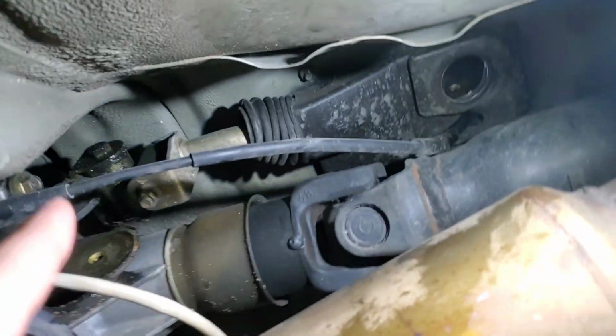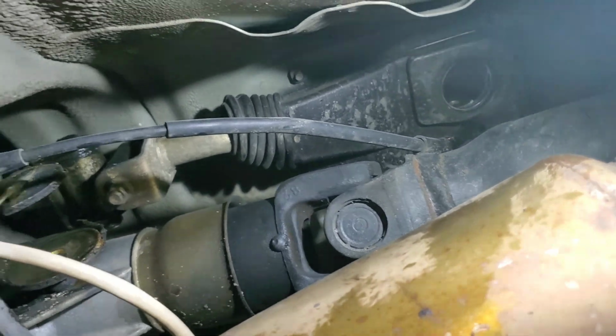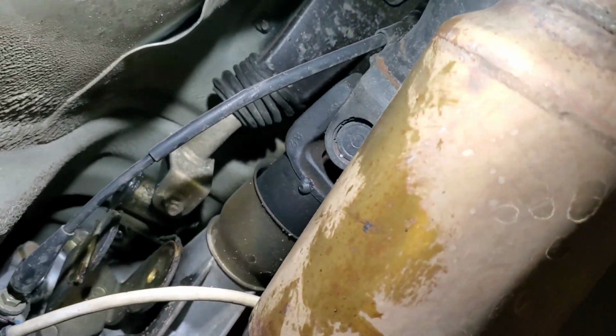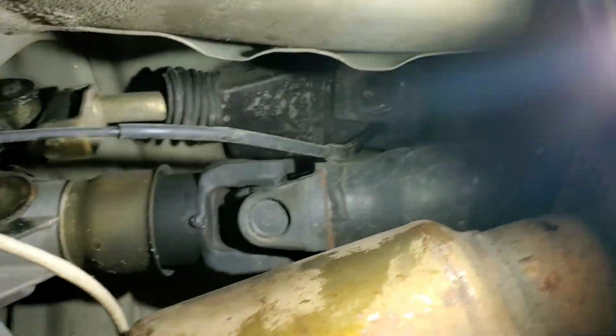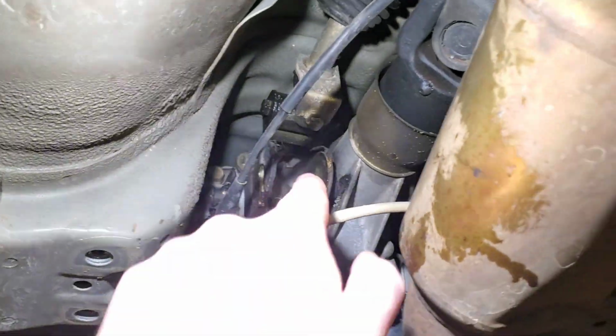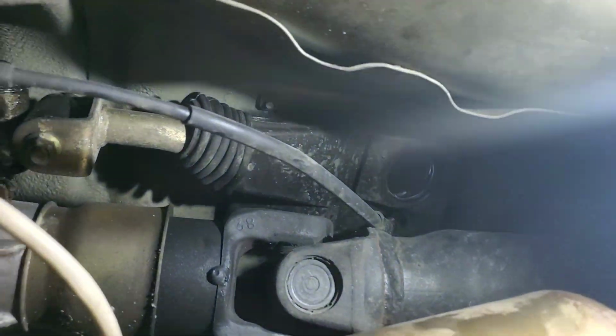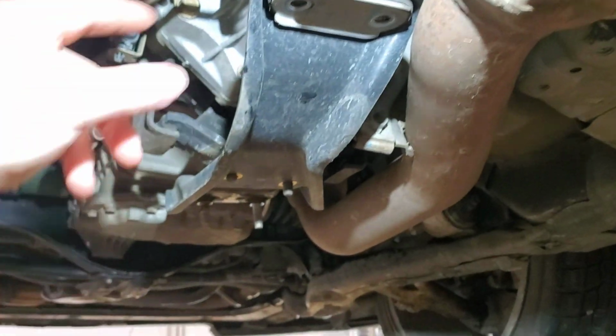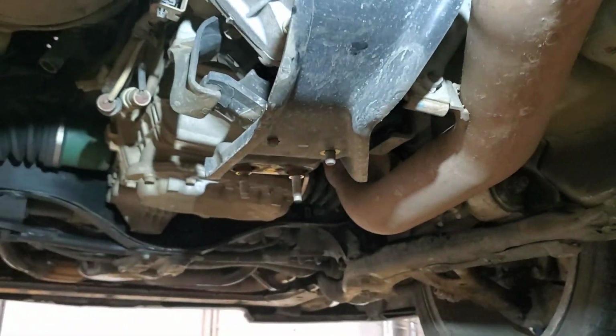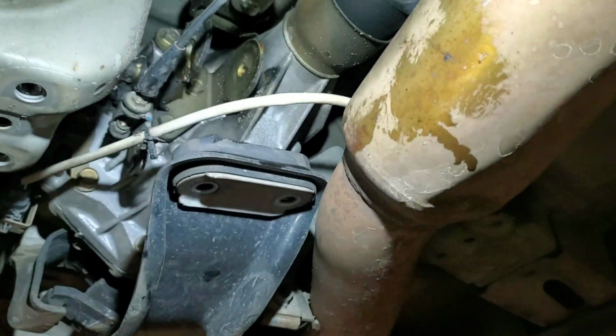All right, so the shifter cradle is out, and I didn't film that because I was over at my leaky Audi. But there's that mount back there, and Raj is just putting the nice polyurethane bushings into the shifter cradle up there. So we did have to drop it down just a little bit, just from the transmission mount. So it hangs down a bit so you can get at everything really easy and nice.